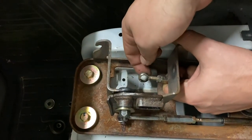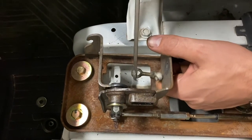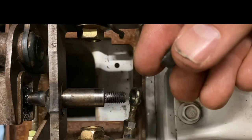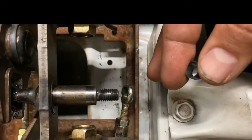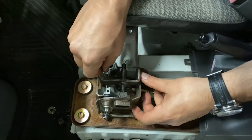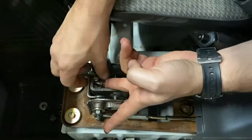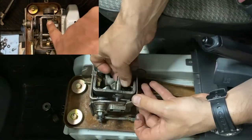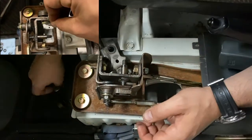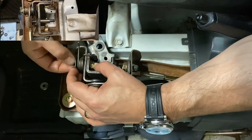The next thing we're going to do is remove this little ball bushing — this one doesn't look bad but we're going to replace it anyway. If you get the full kit instead of the abbreviated, you'll get a second sleeve — it'll just press right in and put back together. Okay, all the bushings have been replaced and put it all back together. When putting it back together, I notice a little gap near the side of this bolt — we'll have to put a little washer in there, provided in the kit. It'll be the bigger of the two washers, one on each side. Your truck may or may not have them depending on if they've worn away over time.